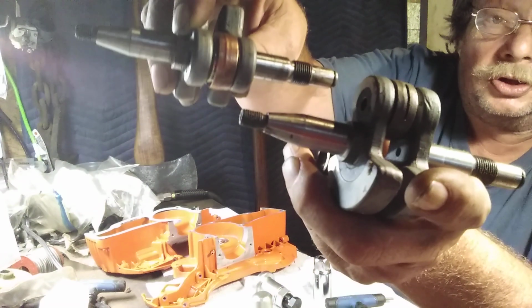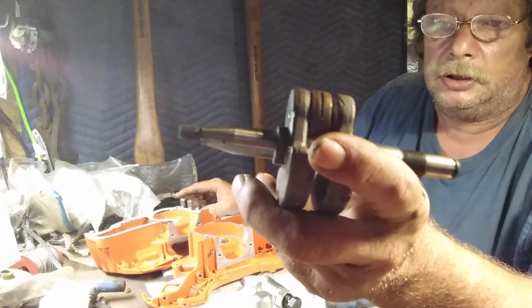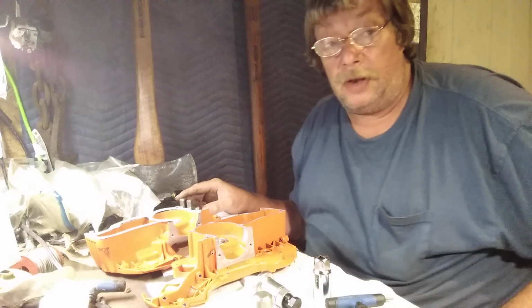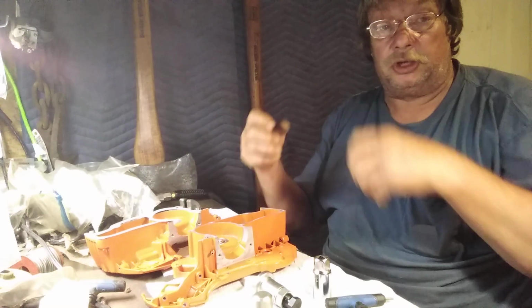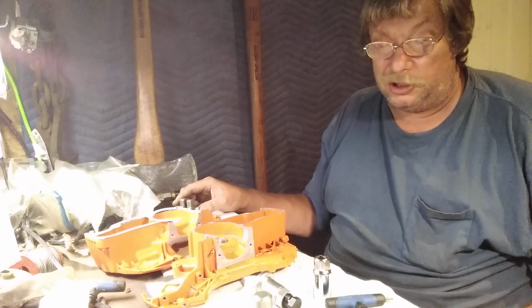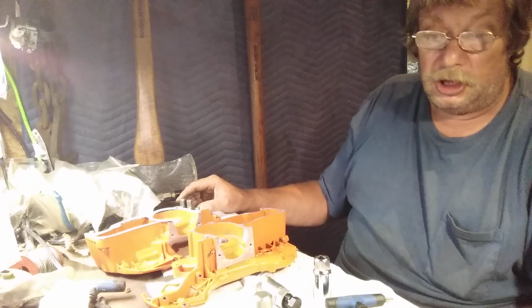Husqvarna knows what they're doing. See, we've got a good OEM Husqvarna, a very good crank. Don't run the others. They don't hold up. That rod stretches and that bearing goes bad. You get one where it's tuned up and running good, and you decide to do a little port work, it's going to come apart. Don't run their pistons or their cranks.